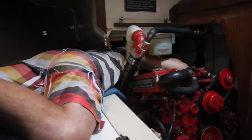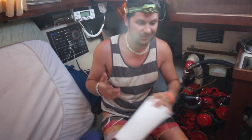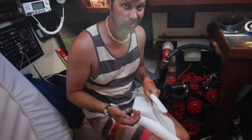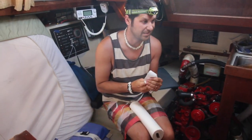It's an uncomfortable position. I can't really find exactly a smoking gun. The whole bottom of the pan is covered with oil, but I did put a wrench on the drain plug and tighten it up just a smidgen. I don't know if it was loose enough that it was leaking, but it's worth a shot. I don't want to go any more because it's an aluminum case and I don't want to strip the threads and have a real problem.